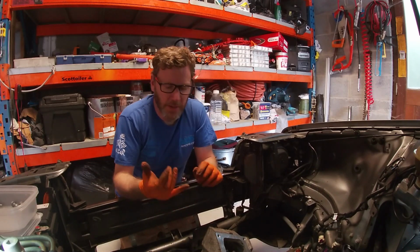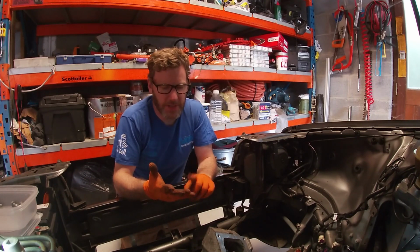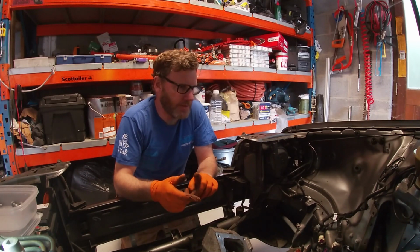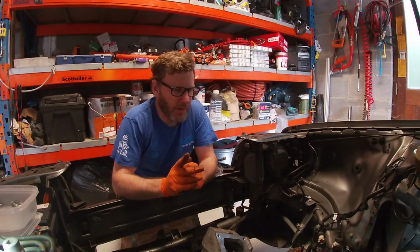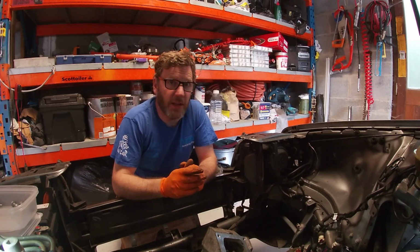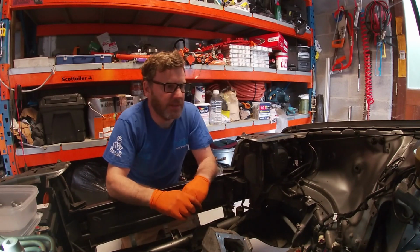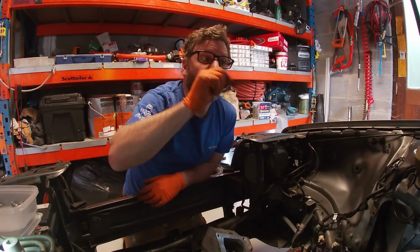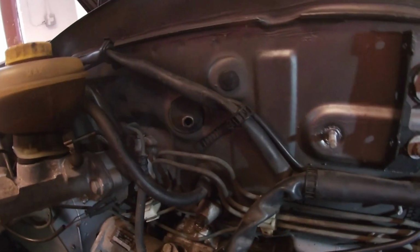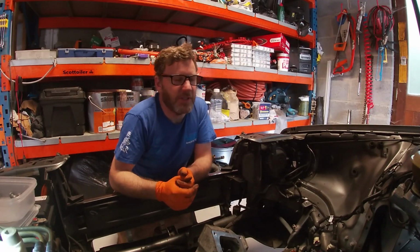into the VCU. So out of the VCU, you have your throttle signal in, your 5 volts, your loop. There's a lot of loop back. Then the contactor positive, switching them on and off. So a lot of these can be repurposed back down there. Originally I fed a couple of 5 volt wires back down into the footwell through that hole there for the throttle, back down to the pedal, the new pedal position.